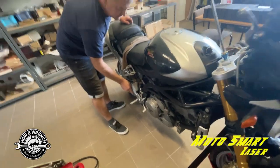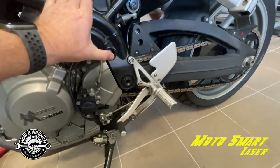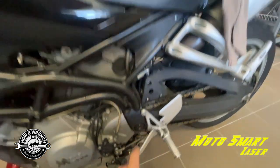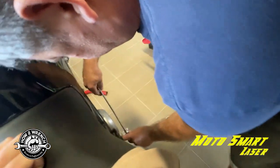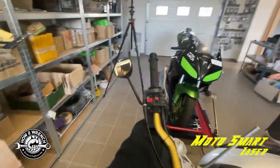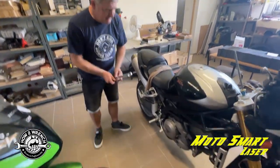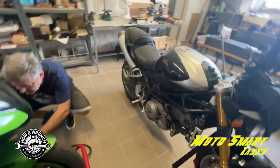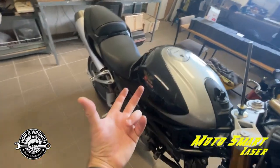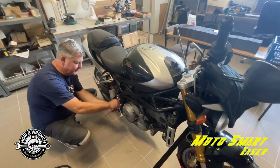What Chava is trying to do using a wrench is slowly tighten it up. We were hoping to capture on video that you could actually see the frame compressing and closing up on the gap as he tightened it evenly — but best to use a torque wrench and look up the spec in your service manual. He mentioned once measuring a motorcycle where both wheels were about 0.4, then after tightening it came back to 0.8. So matching that back to knowing you have to hit the torque spec makes sense — the frame compresses a little bit as you torque it down.